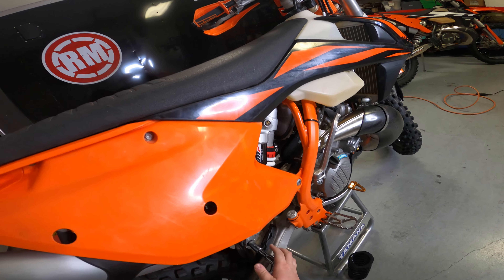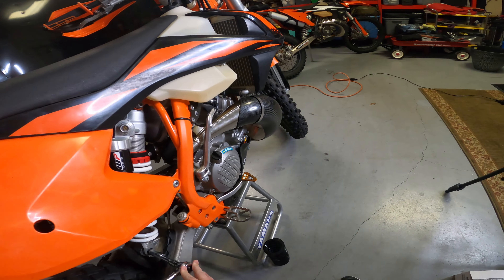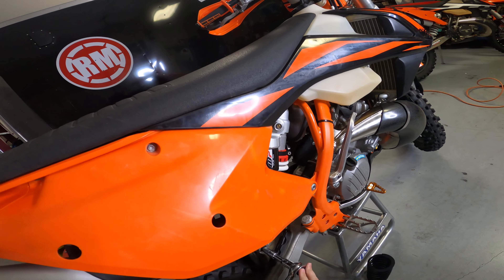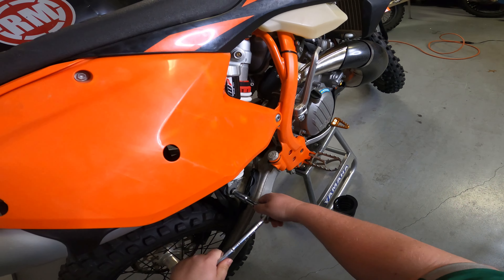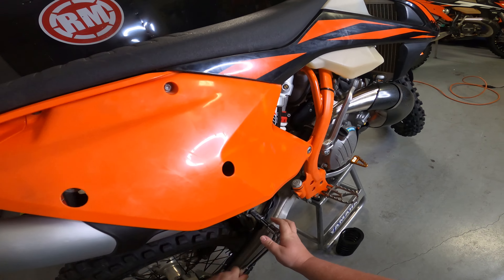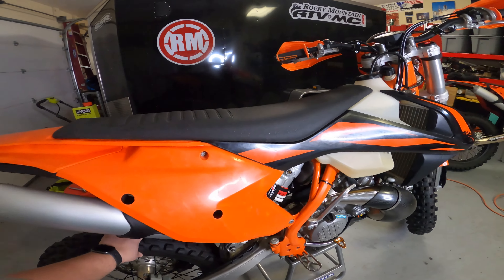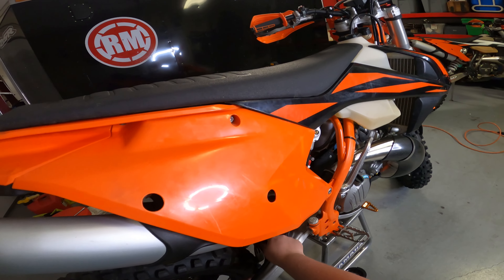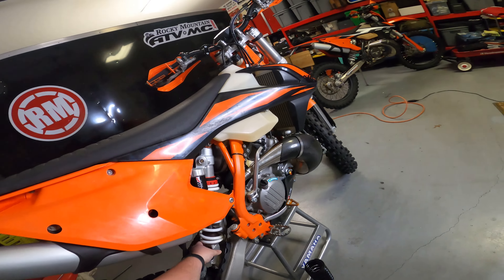All the wide ratio bikes are like that — I personally didn't know that before getting into this. The Husqvarna I had had a linkage assembly on there, which would've been one extra step. So this is gonna be a fast and easy swap. Once it gets loose, all I need to do is pick up on the swing arm and that bolt should slide right out. I'm gonna lift and twist it around, pull it, and there it comes out just like so.